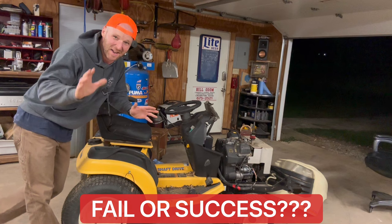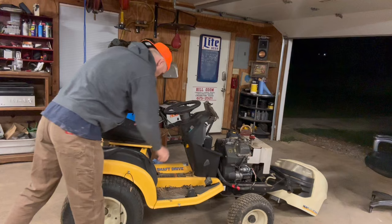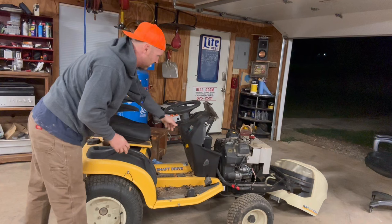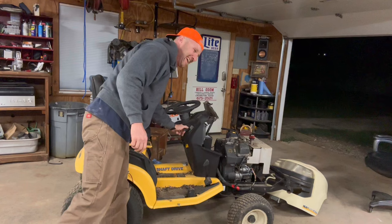So this is my first attempt at it and I have done something horribly wrong in my wiring — but at the same time something really cool happened. Check this out: I'm not even going to sit on the lawnmower. Pull the choke out, turn it to the right one time — and watch this, I'm not even sitting on it, just one foot on the brake — and the starter comes on! That is crazy. So I'm going to have to dig back in to figure out what I did, because we don't want that happening — pressing the brake shouldn't activate the starter. We'll try again.